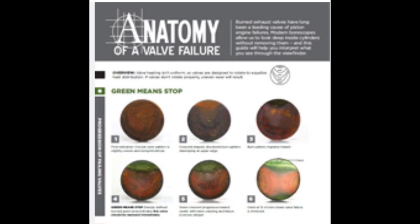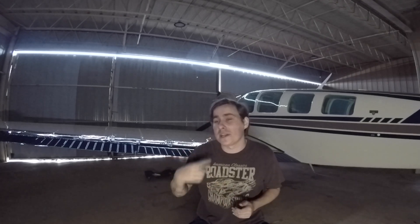Get a good look at your exhaust valves. I'll try to put up a chart of the exhaust valve health guide published by the FAA — they show you exactly what to look for. Make sure you understand that your compression check is just an indication of how well the engine is performing. If it's below 60, it's not the end of the world. Just because it's 80 over 80 doesn't mean it's perfect. You need to look at your compression and your oil together to determine how well your engine is working. If your compression is 80 over 80, the engine has a lot of hours, and you put a flashlight down inside the cylinder, you're probably going to see a cylinder full of oil — and that will tell you the oil is sealing up the rings, not the rings themselves.